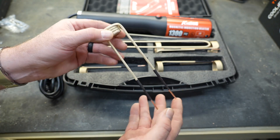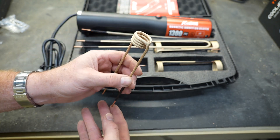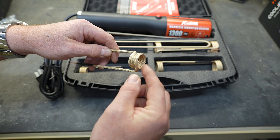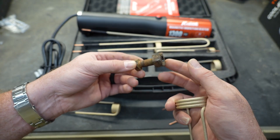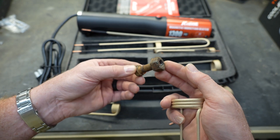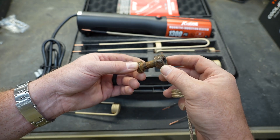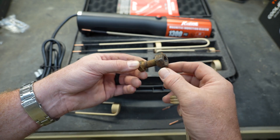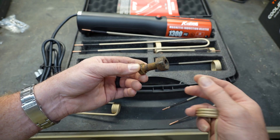In fact, the coils themselves do not really generate the heat. It's the induction that generates the heat, and what gets hot is whatever is inside these coils. Undoubtedly, a seasoned mechanic who has had trouble getting a nut off a fastener has probably used a torch before. That expansion of material does a couple of things: it helps knock the nut loose, but it also allows it to be just a little bit bigger, and you can back it off and take it off.